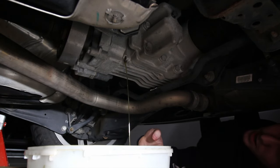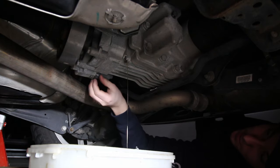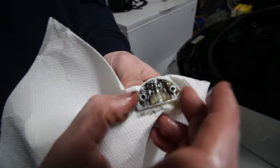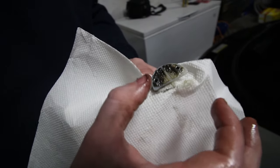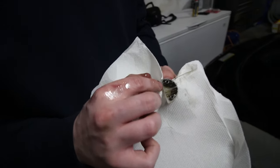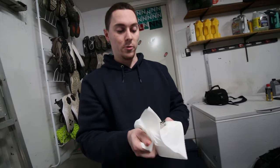While this is draining we're going to go ahead and pull the pump, which has the filter attached to it, off. I'm going to wait for the fluid to drain and then pull the pump off. I dropped the Allen key in the fluid — yes, I'm stupid. So this is a little pump filter screen — this isn't the actual Haldex filter, but this just goes to show you why it is so important to clean your Haldex pump screen, because this is only 70,000 kilometers. The car was daily driven for 30,000 kilometers before I had it, and that's the amount of sludgy buildup that has gotten onto that screen.